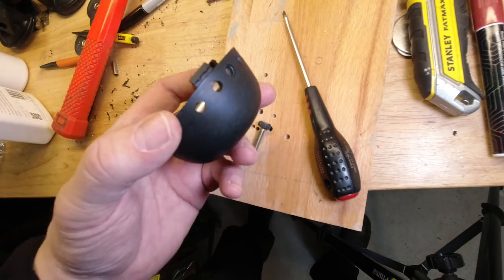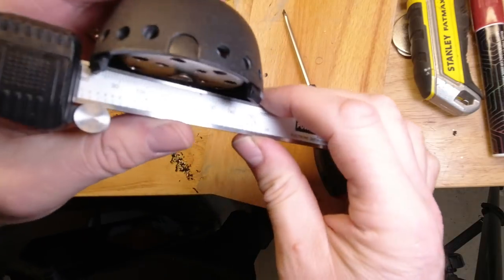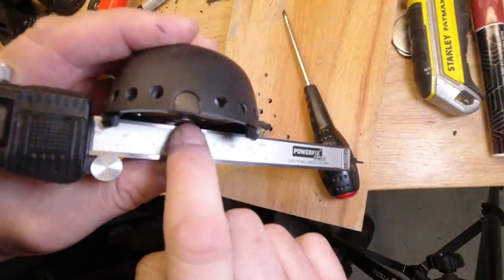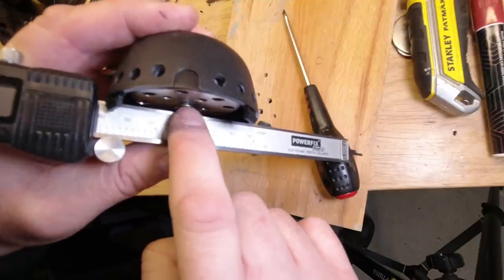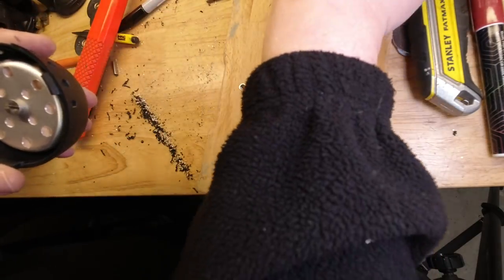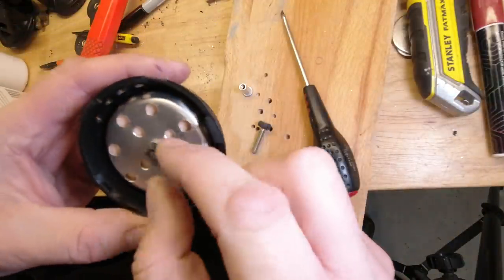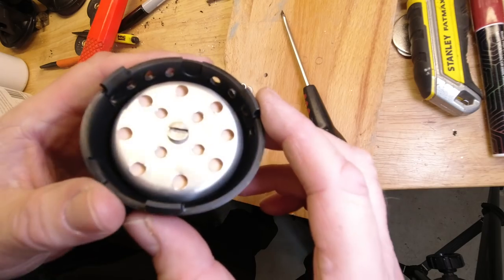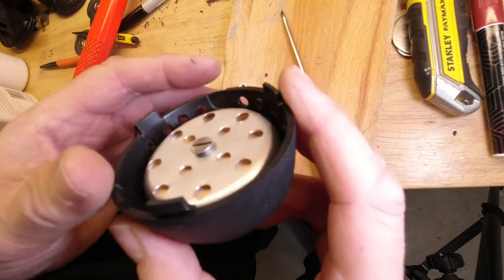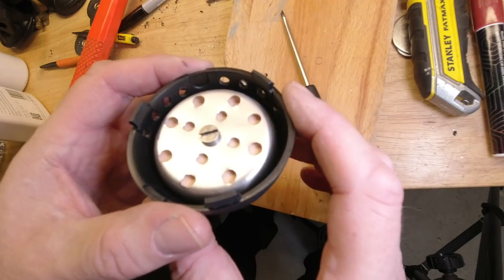So just to make that visual for you, I'm talking about that gap. That's because the tops of the struts poke through just above the surface, so you might need to pull that down or use a shorter bolt depending on where yours are. As the top suspension mounts compress and collapse over time, the top of the strut sticks through further and further. It's one of the ways you can tell that you need to replace them, is how far it sticks out. Mine are 5mm above flush and they're used but in very good condition. So if yours are much higher than that, it gives you other reasons to look at your car.